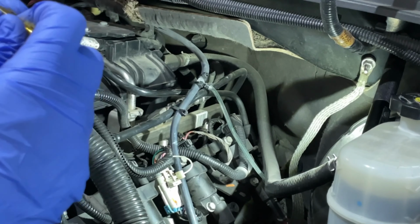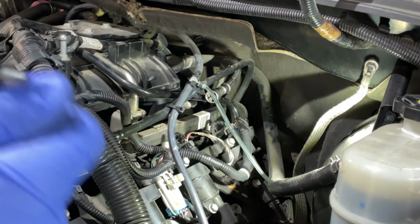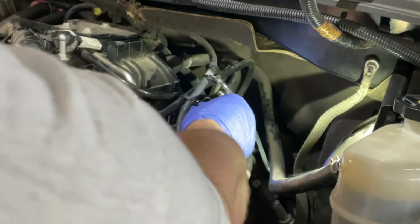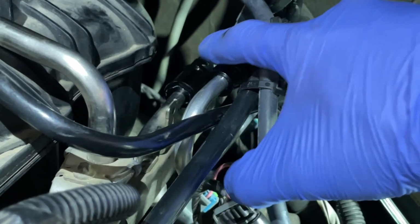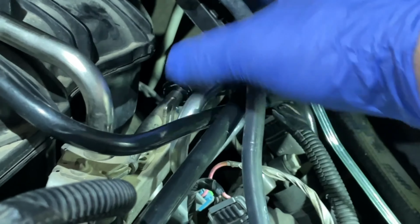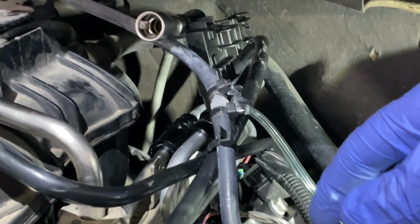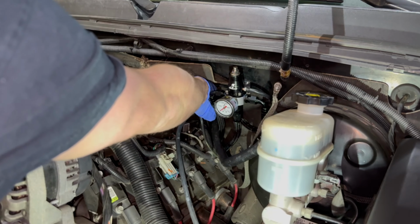We're gonna go ahead and come in back here and do our fuel line. Now we can take our new fitting here. Go ahead and slide this on over. See how I have it here on the frame rail right here. And then that fitting just went right on over. And then this is the sensor right here, which we need to keep kind of low. And then the outlet of the sensor's right back there, and we'll probably run that to a regulator. You can kind of see the outlet of the sensor. Go ahead and try and plug our sensor in back here.